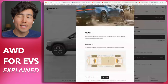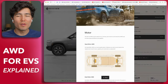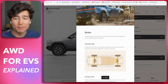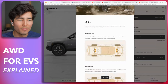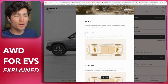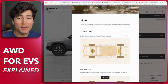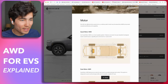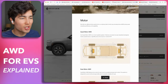So we've covered two motors (the vast majority of AWD EVs), three motors (Tesla's Plaid performance setup), and then there's what Rivian has in their trucks and SUVs: quad motor all-wheel drive. This was basically the only system Rivian shipped until recently. The layout is literally a motor for each wheel. Unlike hub motors, these aren't packaged on the wheels themselves — they're on the axles, using what Rivian calls half shafts, so one motor effectively powers each wheel. This system doesn't need a differential at all because each wheel has its own motor.